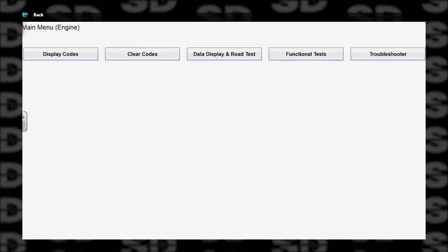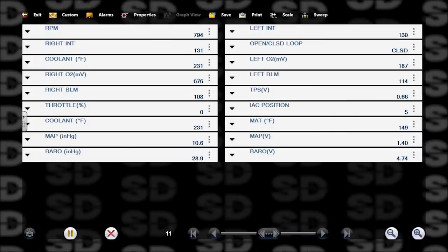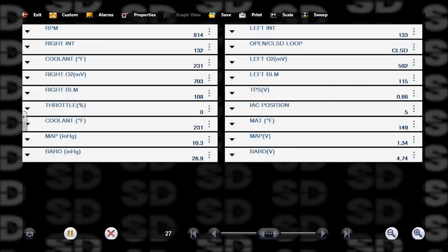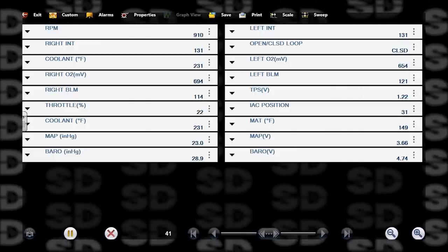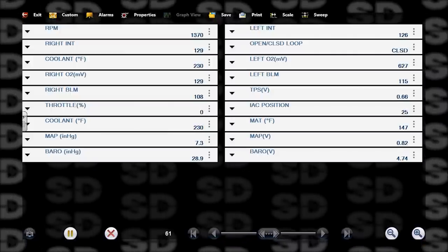All right, so not a great final for you guys, but we're leaving it at this for right now. I'm gonna have my friend drive it and do an oil change on it. There was one other thing I was thinking of while we're in here. It's just weird, some of these older systems and the way they collected data, where the scan tool can mess things up as far as your data parameters go. But it could even be timing chain slack and mechanical conditions like that, which is not gonna fix itself. Just have him drive it.